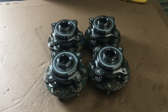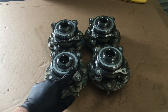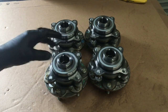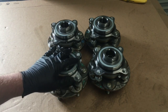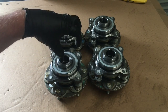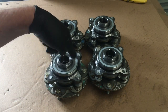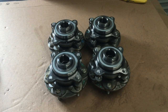The Hilux ones are a pain. There are a couple of different ways you can do them. We still provide that rear seal and there are two other components - either an ABS sensor or a spacer that goes there, plus a retainer over the top. If you want to save a few bucks and reuse your own: it comes off pretty easily with a screwdriver - gentle lever, work around slowly and that ABS sensor retainer will gently come off. Don't bend or damage it. Since we're doing everything else new every 250,000 Ks, we generally just install the ABS sensor and retainer, or the spacer and retainer.